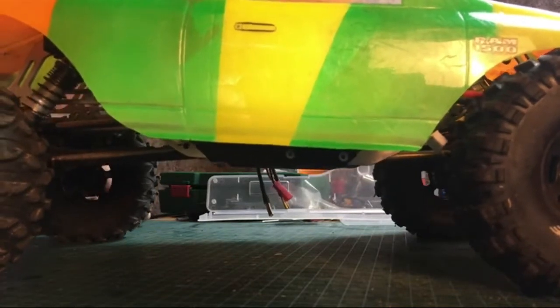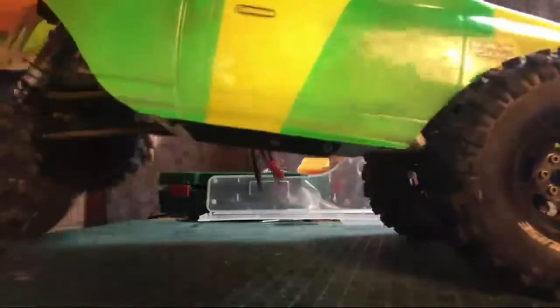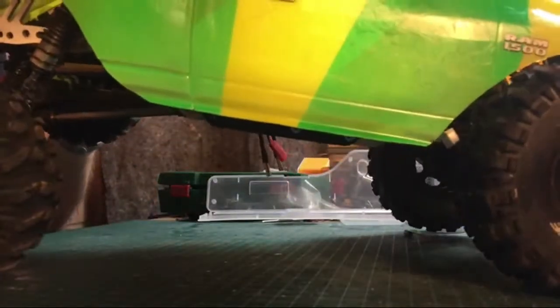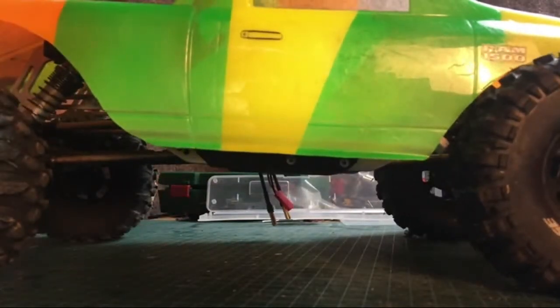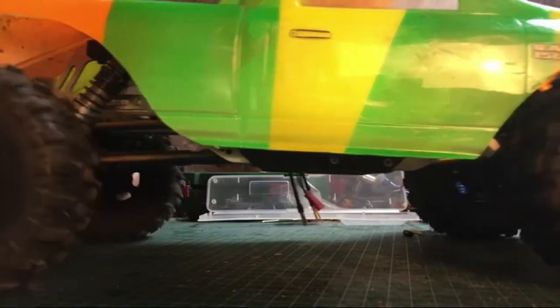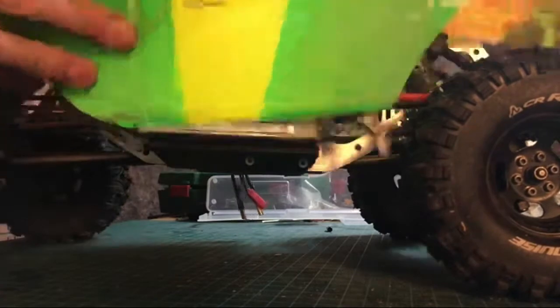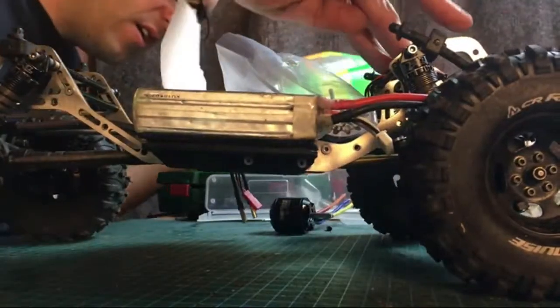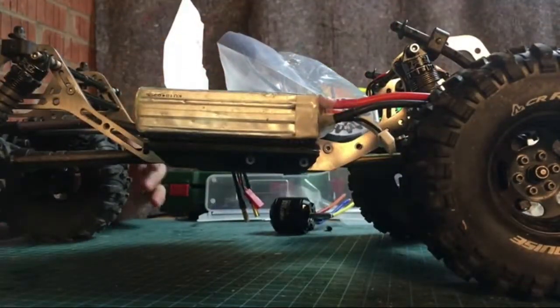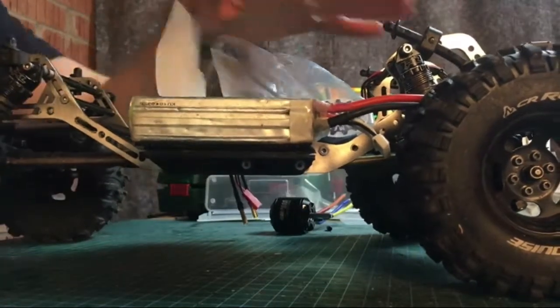But reality is, once it's gone over a few things, the best way to tell is just to twist it a bit. Check the articulation. Yeah, that's got a lot more twist than it had. Yeah, great. Nice angled skid. The skid's not far off the wheel nuts, so we've got a nice low centre of gravity on the skid. Yeah, the front's slammed and the rear's a bit further up, so it could go down there, but most of the weight's at the front.